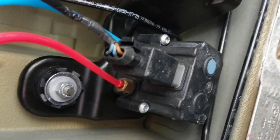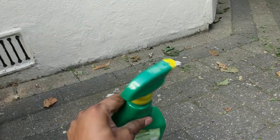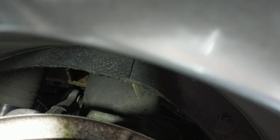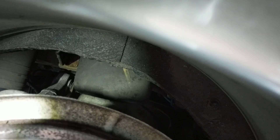So we're going to have a quick look. The way to do it: get one of these empty spray bottles, fill it up with some fairy liquid and water. What we want to do is spray it on that airbag at the back. I suspect it is this side because this side sags a little bit more — eventually they're both on the floor — but I'm suspecting this side is causing the major issue. I'll show you how to try it.